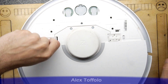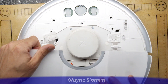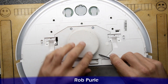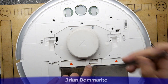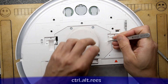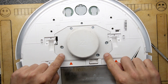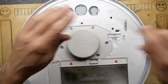Make sure you've turned it off — turning it off is accomplished by holding that power button down. You don't really need to take off anything else. You can leave your dustbin in if you want. Pop these rubber covers — these are covering floating screw heads. When you take the screws out, you'll notice three screws with an integrated washer. Those three go under these covers here, because there's a button there that allows it to detect when that top is pushed.